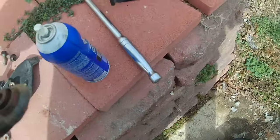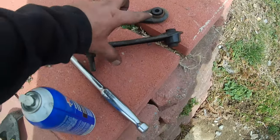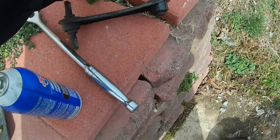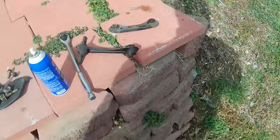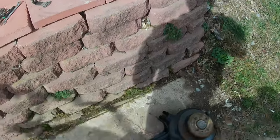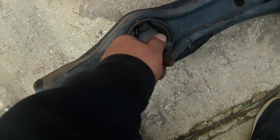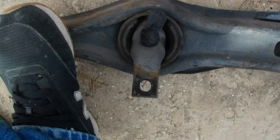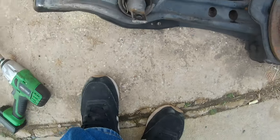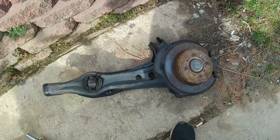The reason I needed to take these off is to measure out the camber kit to get the adjustment, and get the adjustable toe adjusted. Let me grab the other arm and we'll start getting that stuff lined up. I want to show you the condition of this trailing arm bushing - I'm glad this didn't fail when I was on track, but these trailing arms aren't going to be used anymore. They're definitely going to be spares.